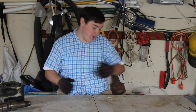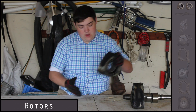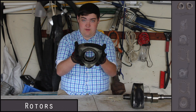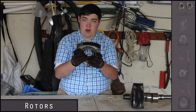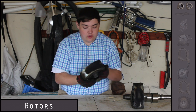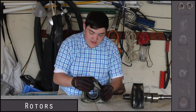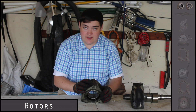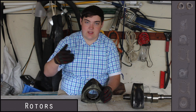It comes apart horizontally, if you will. We'll start from the front and move towards the back. To kick off the video we'll start with the obvious, which is the rotors. This is a 12A rotor — there are two of these per engine — and as you can see there are little grooves at the tip of each of the triangles, and in there is a little piece called an apex seal. The apex seal is what touches the edges of the housing and sections off each combustion chamber to allow combustion to happen and to keep compression.